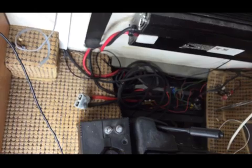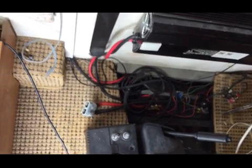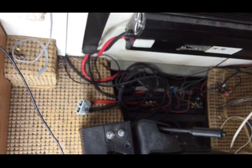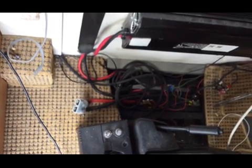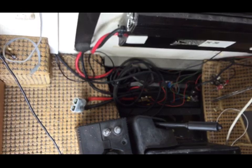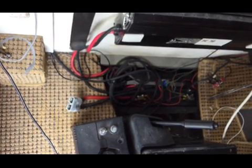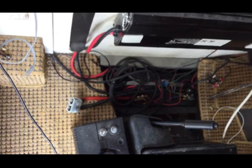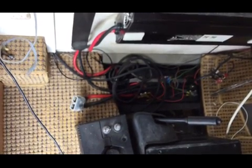Now down there there's a load of wiring that's not wired up correctly, because the two batteries are supposed to be parallel wired, and from one battery there'll be a positive, and then on the other battery should be all the negative stuff, or vice versa, whichever way around. Now I'm going to redo that, because on the second leisure battery, which does sit on top of that, it's parallel wired into that battery, except none of the negative or the positive cables are attached to it. So essentially that single battery there is powering everything, and the other battery on top is basically just feeding it bits and bats, and I'm not sure if it's charging up correctly. So we'll get all that wiring done correctly, and we should hopefully see an improvement in battery performance.